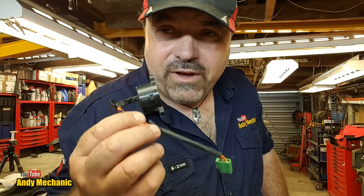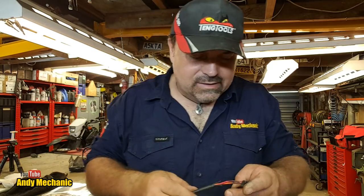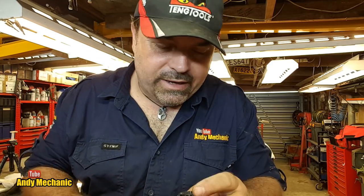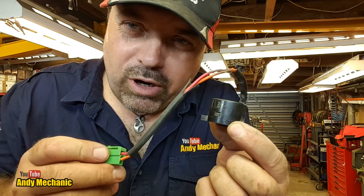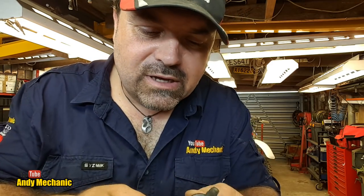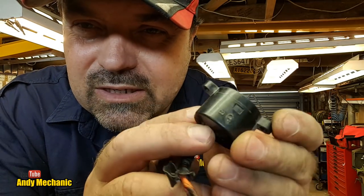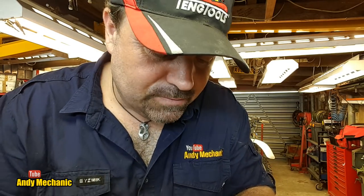So that was pretty cool. Managed to get it fixed with zero cost. Ivan will like that. Okay, I did use another ignition barrel, but it didn't cost me anything, basically. It was a scrap bike. So I'll probably do a separate video on pulling this apart, and we'll take a look and see why it's failed. Not the reason why it's all burnt, but I want to know what's going on inside there. I reckon I can get it apart. It's got little tabs on either side, so I can push those in. There'll probably be some springs and ball bearings that fly out, but we've got nothing to lose. We'll see if we can work out why it's permanently closed circuit rather than a switch, which should go open circuit and then closed circuit, depending on the key position.